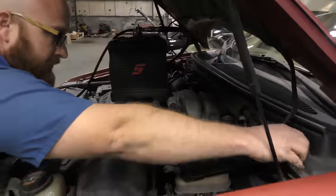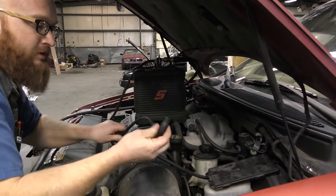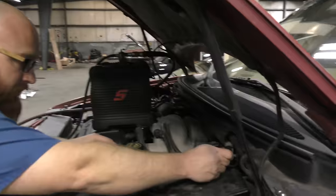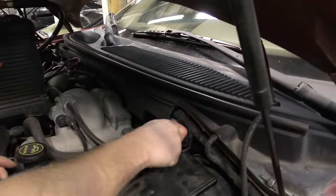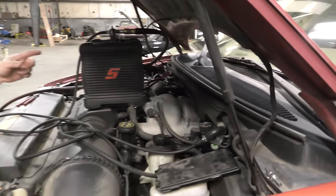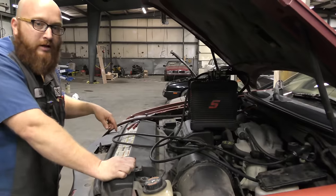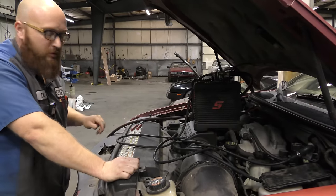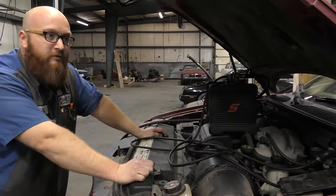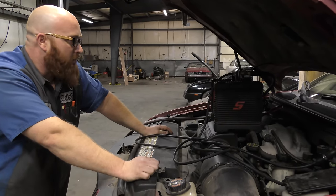And there we go — set that aside. I have this little elbow that I use just for these. It fits right over the port, just like so. Then you turn on the smoke machine and wait for a little bit to let it fill up the system — all the pipes, hoses, and your gas tank. It's going to fill your gas tank up with smoke. It's inert — it's not going to catch fire or do anything.